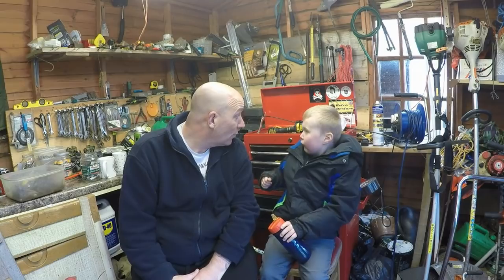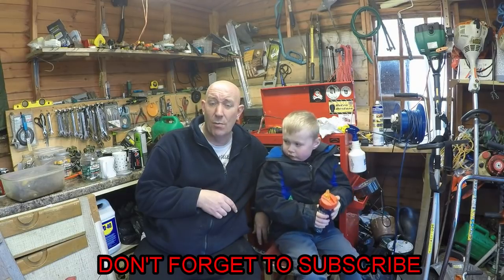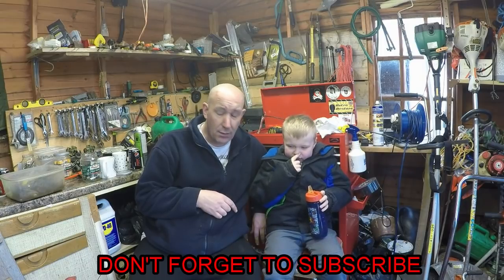Okay, so all in all, that's not a bad little fix. The lawnmower in the end costs us absolutely nothing at all — got it for free, which is always good. So yeah, that costs nothing in the end, I'm well chuffed with that. I had a couple of spare cables which I was able to work around. I had to put a couple of knots in the dead man's handle cable, which is common practice, because the cables do stretch and I'm not forking out £15 for another cable. The drive's now working. It has got a little bit of a priming issue, but with those style engines, if you prime them ten times rather than two or three, the lawnmower will start. Thank you very much for watching this episode of Mixed Mowers, and we'll catch you again very soon on the next one. Take it easy.